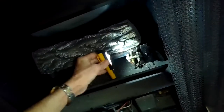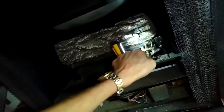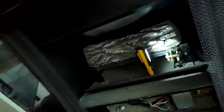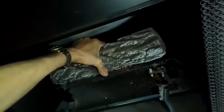Cleaning this little pilot hole will help, and we usually just use a wire brush — pretty easy to do. I'm using the wire brush to clean the part called the thermocouple, which is what senses the heat. I'm also cleaning the electrode that produces a spark, and cleaning the little hood where the gas comes out, because the spark has to jump over to that and if it's dirty it won't make a good spark.